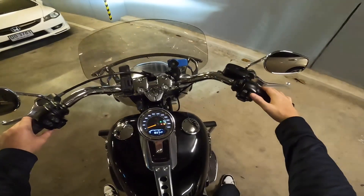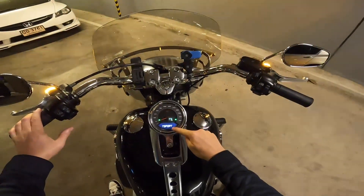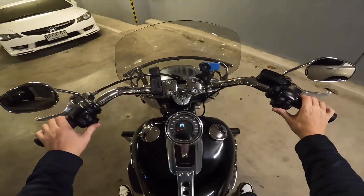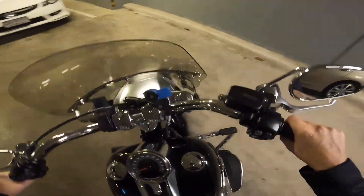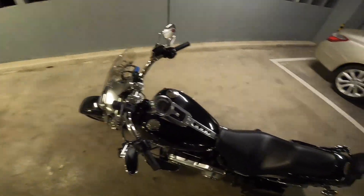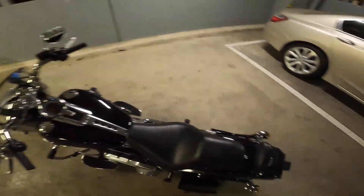So you have the ignition on, you turn it off, hold left and right indicators at the same time, and you see 'T mode active' — it's that simple. Now you try and move and wiggle the bike — normally the lights would flash and the alarm would possibly go off, but that's not going to happen now. The bike is in transport mode.